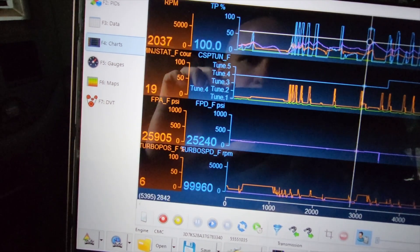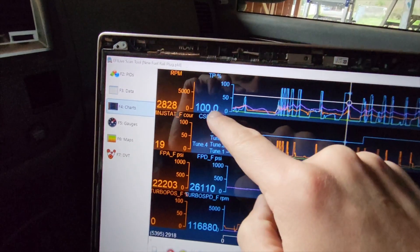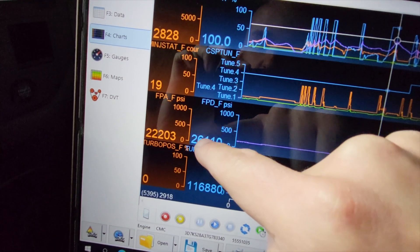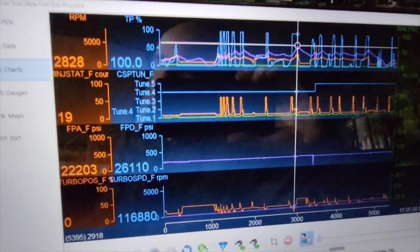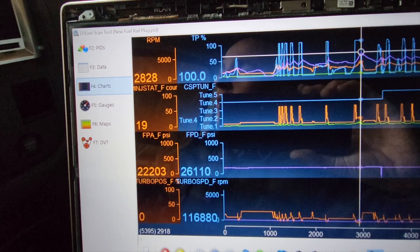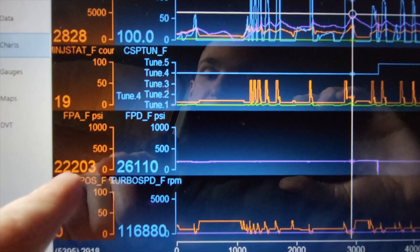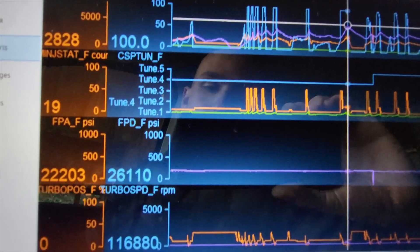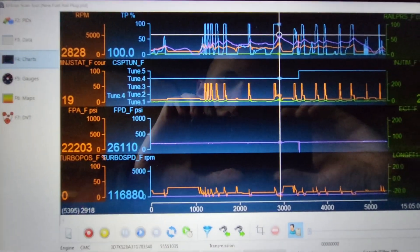I got a little wild with her for a second — 87 miles per hour, 100% throttle. Our actual 22,200 is close, and 26,100 was the desired. So in sixth gear, going ham, 100% throttle at 90 miles an hour, that pressure is a lot higher than with the stock fuel rail plug. I know there's a lot of controversy around this, but I'm just looking at it and saying, well, that's a lot closer than what it was before when it was less than half. No codes were thrown, so take a look at your fuel rail plug — Google it yourself. I just wanted to share those results with you guys. Peace and love.